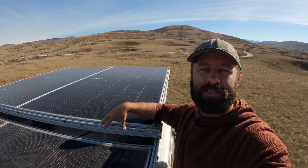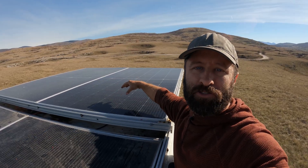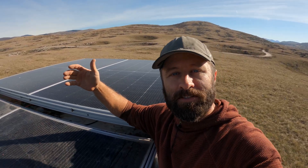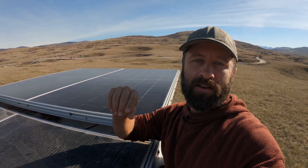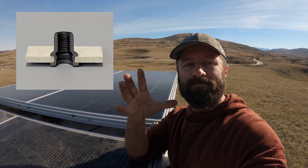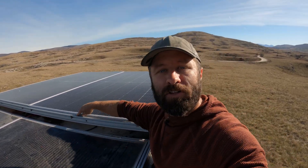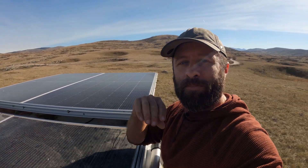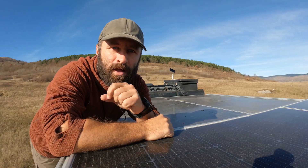For the giant panel frame, it's basically four pieces of extruded aluminum forming a perimeter with one down the center as extra support. I put rivnuts into the frame of the solar panels — a rivnut goes in and you use a tool to pinch it tight, creating a threaded portion. I made a bunch of those around the perimeter of each panel, then used bolts to through-bolt through the extruded aluminum. I considered just attaching to the extruded aluminum, but figured through-bolting would be stronger and more secure, especially since we do a lot of off-roading and bouncing.